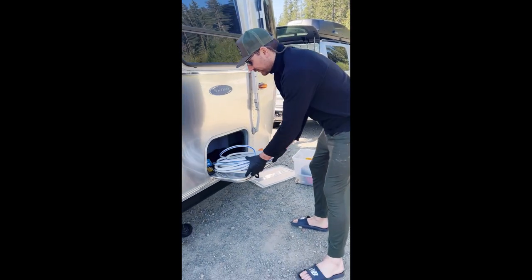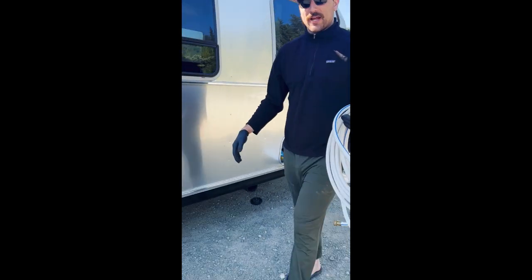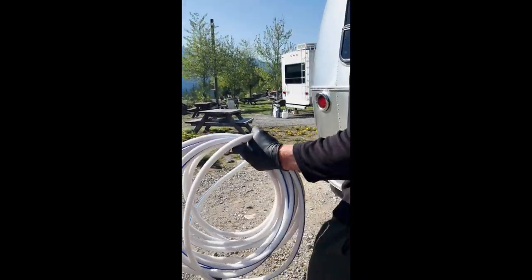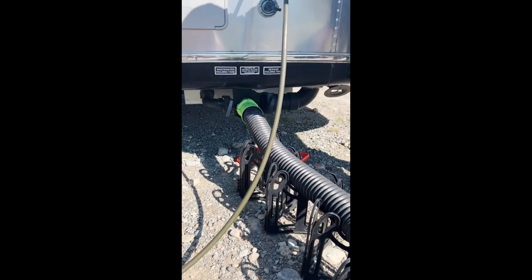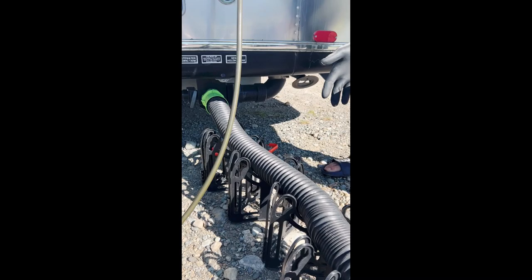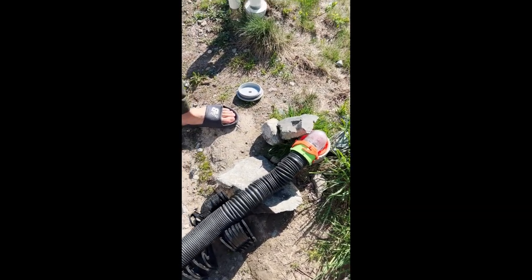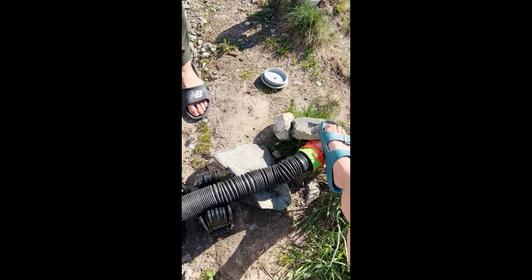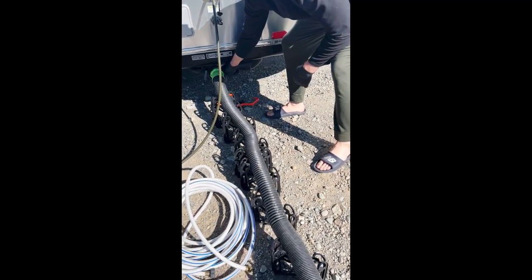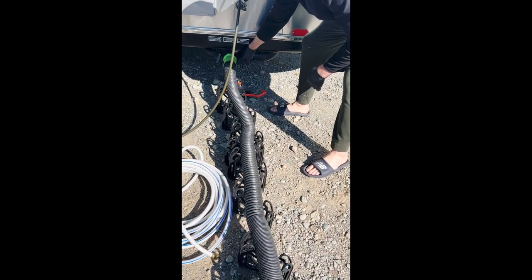Now we're going to do the sewer. We're going to get our flush hose — this is what we're going to use to flush out the sewer tank at the very end. For right now, we're going to focus on flushing out the tanks. We're always going to start with the black tank. We have your gray tank and your black tank — remember, your black tank is from the toilet. So you're going to want to take extra precaution because we're going to be flushing waste right now. Make sure that this is secure — I always like to have somebody put their foot on top of it. If you're by yourself, make sure that it is very secure before you release this valve. At this point, we can release the black tank. Release it slowly — just pull back on it a little bit. You'll start to hear the water and solids flowing out. As they start to come out, you can release it more and more, so that by the end it's fully released. Wait for it to be completely done flowing.